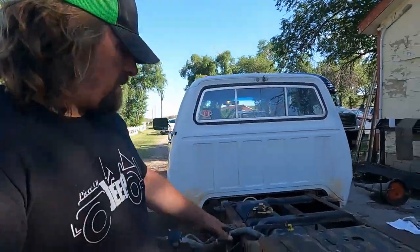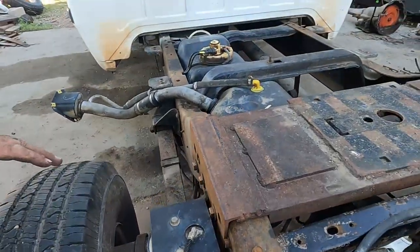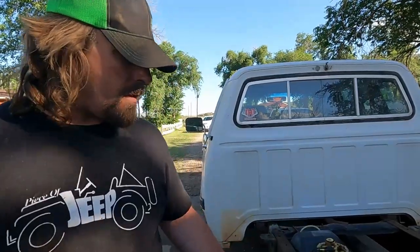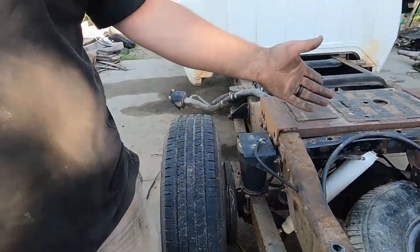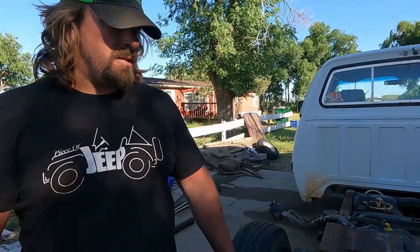Well, it's seven and a half hours later. I'm really not sure what happened — I don't know where all the time went, but here's what we got done. We got our plate bolted in and our airbags remounted. We did move them down a little bit because they were pretty stretched out. We just used the bolts that were in this when it was installed on the last vehicle — it did fine there, it'll do fine here. I re-plumbed the airbags with new lines because they were leaking before, and I covered them in split loom because the frame rubs holes in that plastic. So it should last a little longer this way.